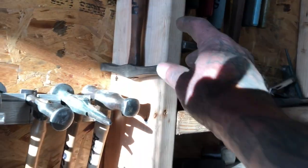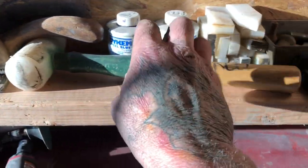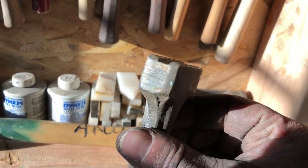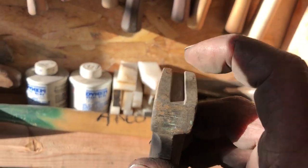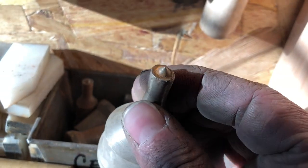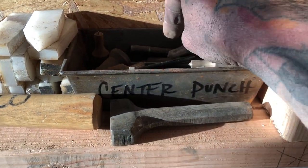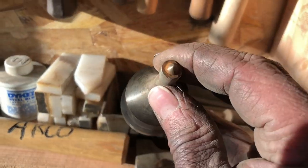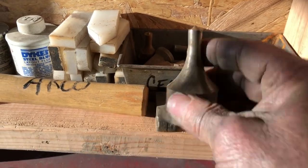On the sides I have various tools — sorry about the sunlight, it's kind of bright in this spot. I have my body files right here, a bunch of those with the new files. This is my shaping hammer — I use this for my beater bag. And then I have special tools for folding fender lips and stuff over. I use these center punches. If you guys don't have a set of these you've got to get some — when you're doing fabrication they're amazing. An old guy here in town gave me a big pile of these. They're like old military style or something, really old and just amazing — awesome tools.